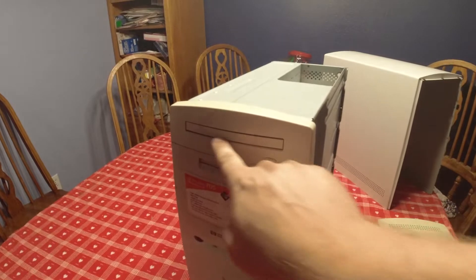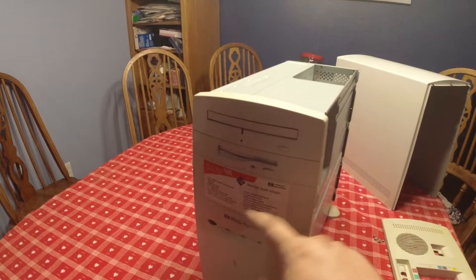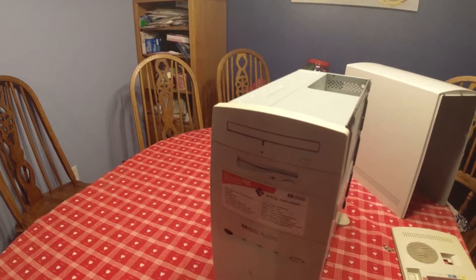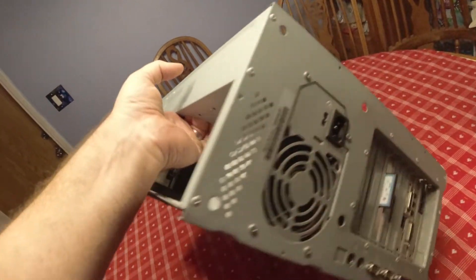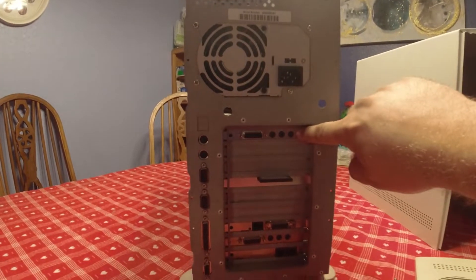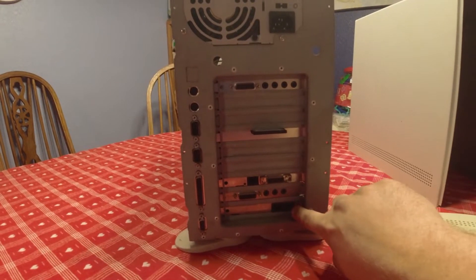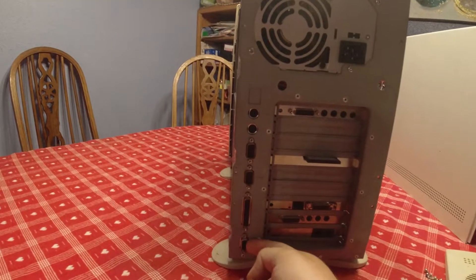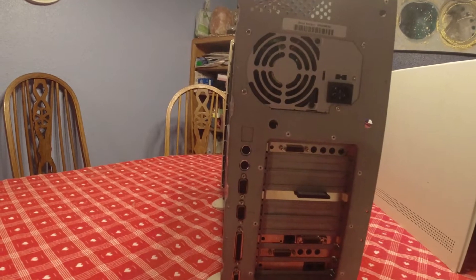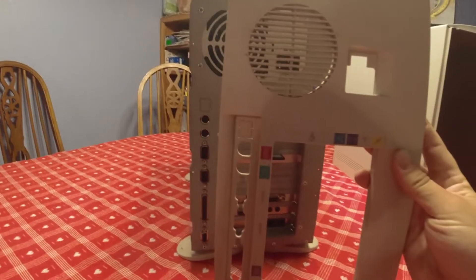At the front of the unit we have the 6-speed CD-ROM drive and one standard 1.44 megabyte floppy. Behind the cover is an additional 5.25-inch and 3.5-inch bay, but I'm keeping the cover and sticker because I like the way it looks. At the back we have the original broken sound card, the CF card, 10BASE-T Ethernet, the Sound Blaster 16, the modem, VGA, parallel, two serial ports, PS/2, and a knockout for what would have been a second PS/2 connector, plus a back panel with everything nicely color-coded.